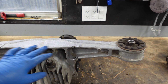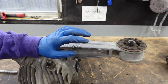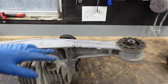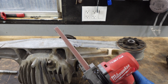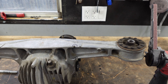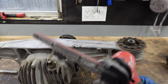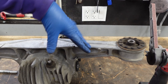Step one is to clean. There's plenty of ways you can do this — you can sit here with a Scotch-Brite pad and scuff forever. You need to get through the oxidization on this aluminum because if you try to weld to it now, you're going to get some really nasty splatter and it's just not going to hold. I'm going to use this Milwaukee finger sander — it's an absolute lifesaver. I've done it before with grinding wheels but you can't really get into these tight pockets. Harbor Freight has air-powered ones that are cheaper if you're not Team Red.